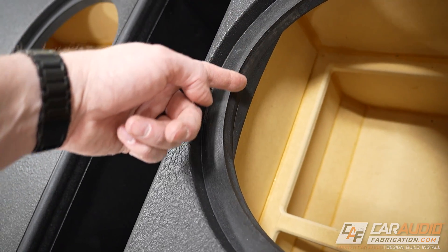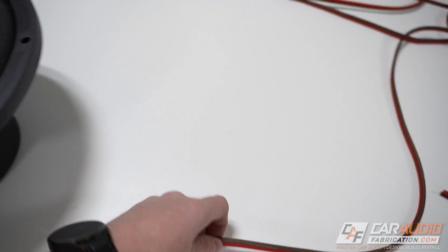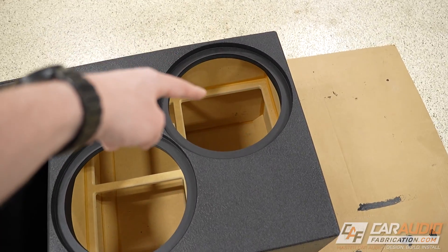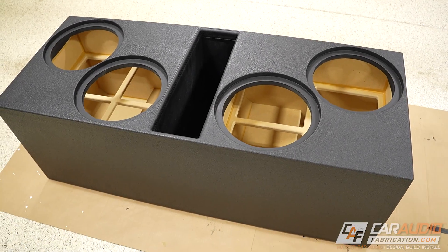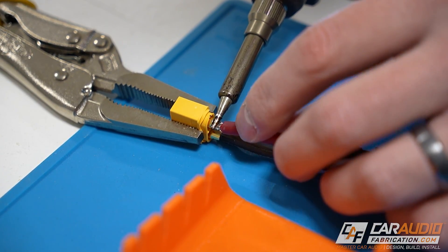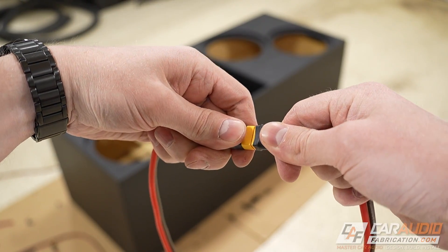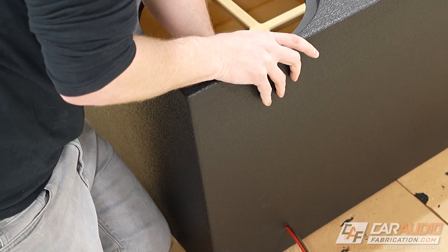I also took the time to do that flat black paint on the part of the 45 that we machined using our router in the previous video. Now we need to get our subwoofers mounted and wired, so I'm going to be using some New Concepts 12-gauge wire. On each side of the enclosure, I'll be wiring the subwoofers together in parallel to present a 2-ohm load at my connection, and I'm going to have two 2-ohm loads which will allow me to wire down to 1 ohm for this total enclosure. I need to wire in some quick disconnects on the speaker wiring. I have a full video about these on the channel, and if you're interested in one of those soldering stations, I make them and sell them on my website caraudiofabrication.com. Once I've done this for each connector, I now have the ability to quick-disconnect this wiring. I'll guide the wiring through a small hole drilled in the enclosure, and of course I'll seal up that hole on the inside as well so that we don't have any air leaks.